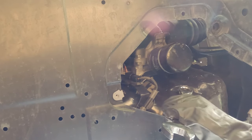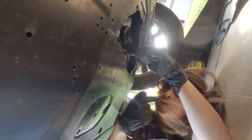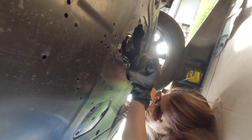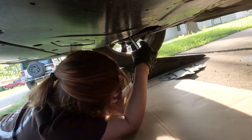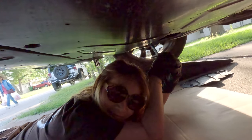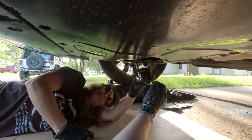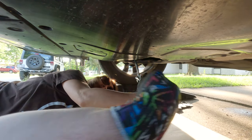Alright, so it's a 17mm. Go ahead and loosen it just a little bit but don't take it all the way out. Counterclockwise — towards you. If you need a little bit more leverage, what you can do is take another wrench and put it in there like that. Now you can push down on it all the way out here and get more leverage.